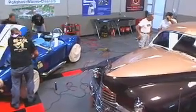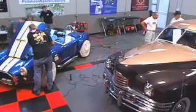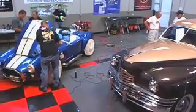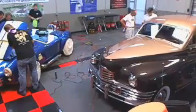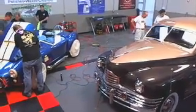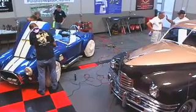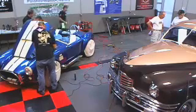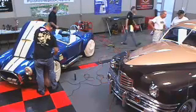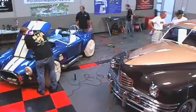Bump that speed up to the 6. Go to the back. Okay. And when you're using these 4-inch pads, they're kind of thick. What you want to do is see those black marks, make sure you see that thing rotating. Right now. There you go. See it rotates a little better now? Now you're taking swirls out. Wow, this looks really good back here. You guys did an awesome job. What do you think, Pete?